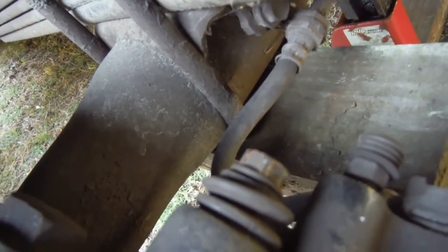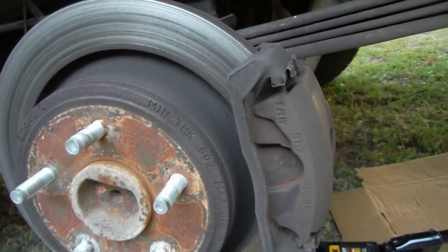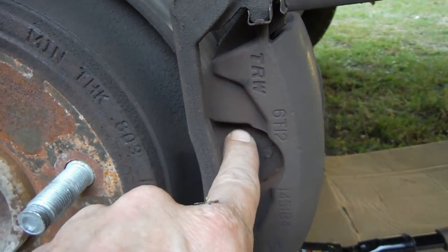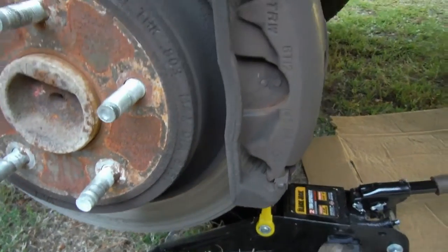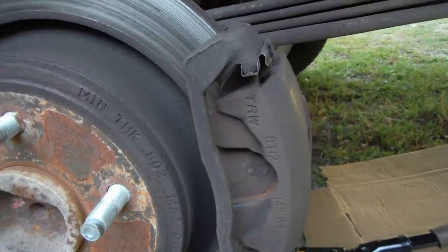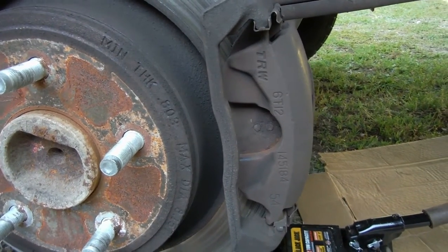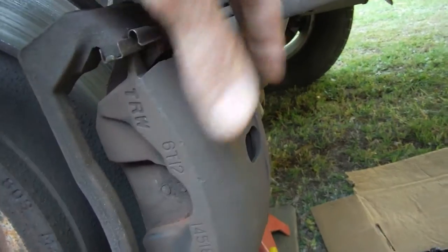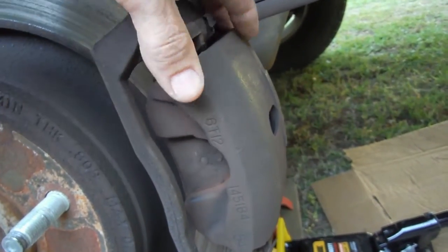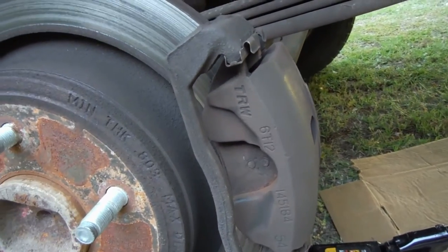Come up here and we get in the back. You'll see right there, there's the nut right there, and there's one — see how it's got the little spongy looking little dealies there — and there's another one right here on the bottom. Those are the only two bolts that hold this caliper onto the vehicle. So we'll go ahead and take those out. Then I'm going to use my C-clamp — put this part right on the pad and that around the back side — and give it a little crank. I never really did that before, but I've found recently it is way helpful because you'll compress the piston slightly in the caliper, just enough so that the caliper, once you take the bolts out, will just pop right out.